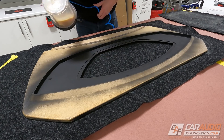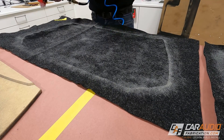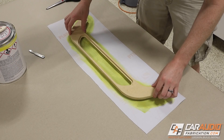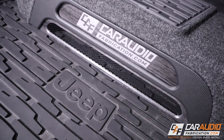The next common fabrication mistake that I see made is not using the right upholstery adhesive. When we're in the final stages of a build, we're going to be applying our upholstery materials, whether it be carpet or vinyl. Usually we've spent a bunch of time making sure that all of our pieces are nice and smooth, so we want to make sure that once we put those upholstery materials on they are nice and smooth as well, and that they're not going to lift or wrinkle over time. To accomplish this, we need to use the right upholstery adhesive. The commonly available adhesive I like to use is DAP Weldwood Landau Top and Trim adhesive — I'll drop a direct link in the video description. It's a contact adhesive, which means you apply it to each surface, allow it to dry, and then stick the two surfaces together, and that stuff is not coming undone.